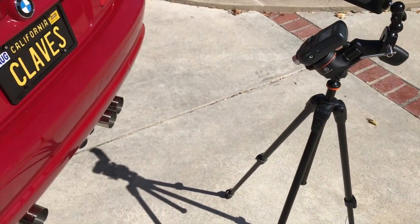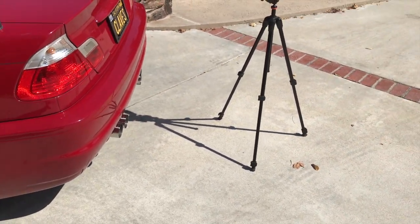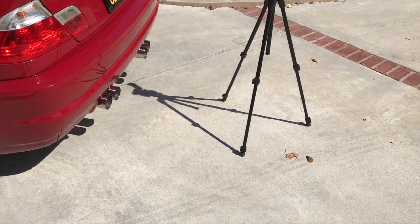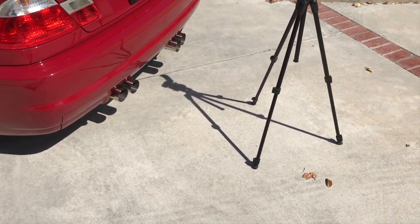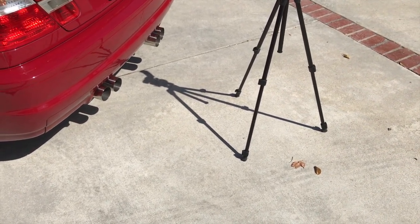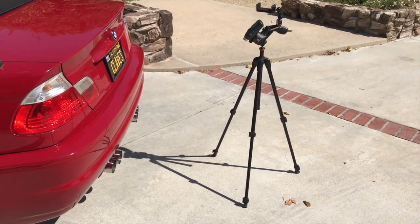So that's how to do it. In California, if you're over 95 decibels, you're too high. I don't think that bursts — or when you rev it, if it goes over 95 — I don't think that's a problem, but your standard operating average should not exceed 95 dB. So that's how you're going to check your dB level.